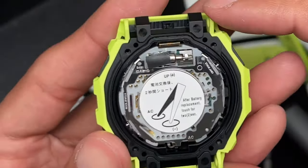Here's your buttons themselves. The buttons are connected with that U-shaped ring. So to remove those, you pretty much just use this here and flick them out of the position and the button would literally come out. That simple, that easy. They're a pain to get back in, so I'm not gonna do that. But if you do choose to remove those, that's how you would do that.